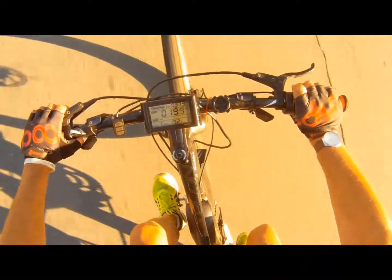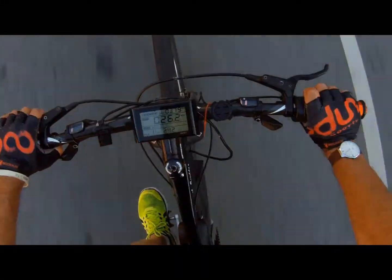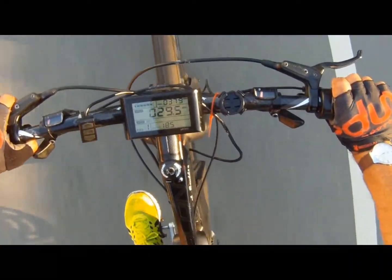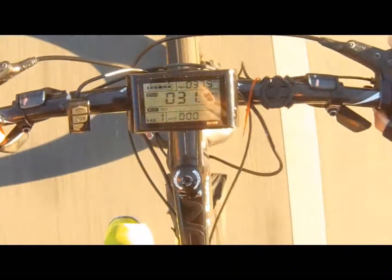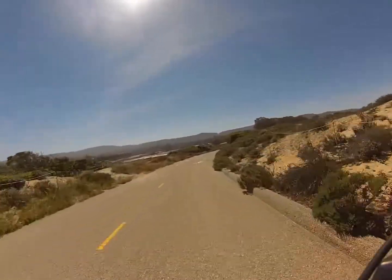One of the things to consider when looking at e-bikes is the battery — it's critical, it's your gasoline. In my case I have 840 watt hours, which is 48 times 17.5. If you divide that 840 by 20 — the 20 being you lose basically 20 watt hours per mile — I can get about 42 miles just using the throttle on that battery.